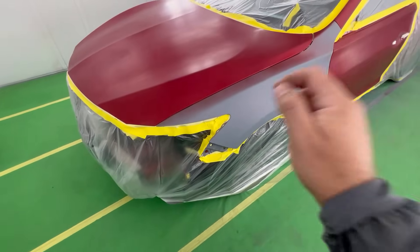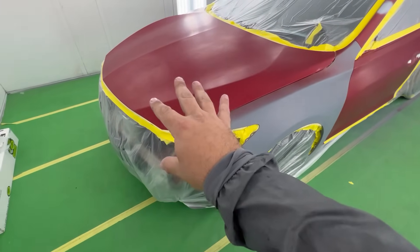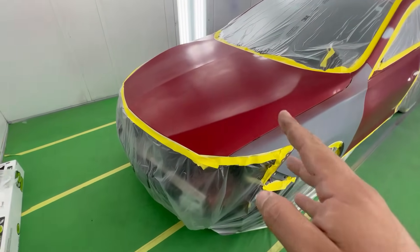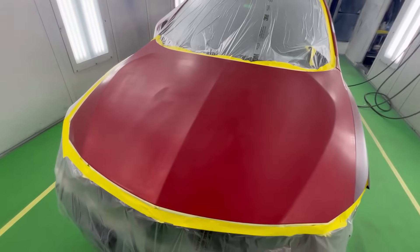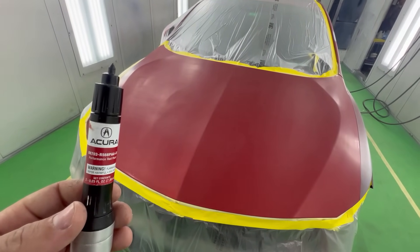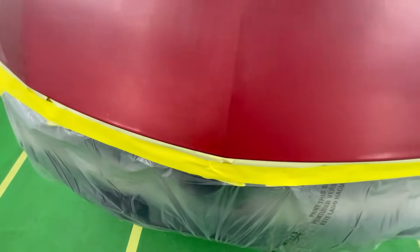Here we have a fender replacement and we're going to do a hood blend. This hood has seen better days as far as dents and scratches go. I want my viewers to understand that a blend is a blend — we are not here to repair work for free, like dents and scratches. Since we work at a dealership and paint the same cars all the time, this is what I use for a touch-up. It's thicker, it sands better. You touch them up, sand them down. It will never be perfect but it will look a lot better.